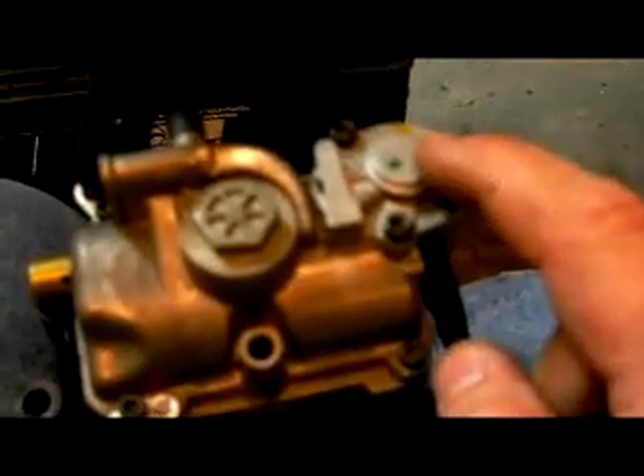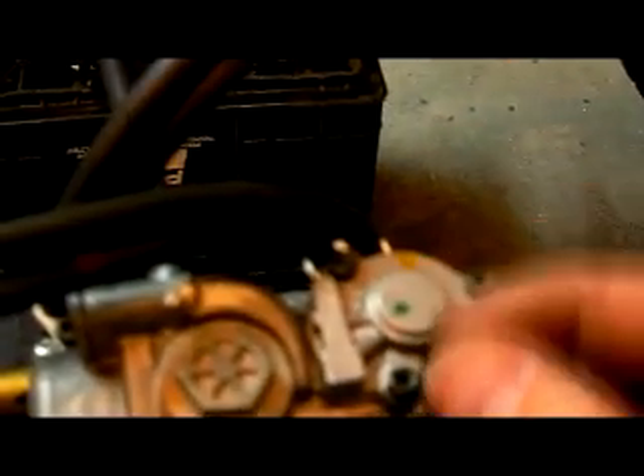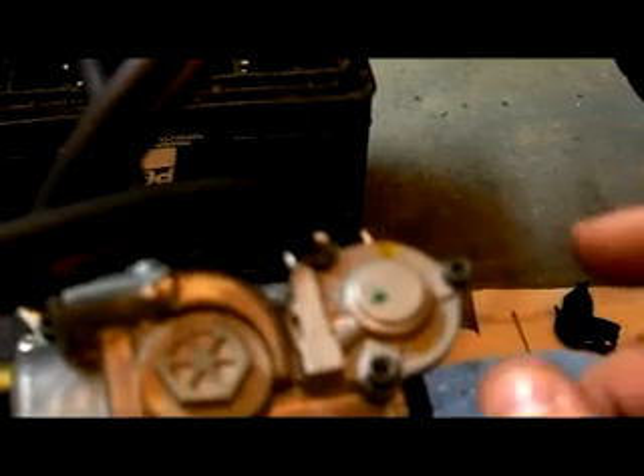Here we are with the carburetor in hand and I'm going to get to work on the JD jetting kit. Under here is the accelerator pump, and underneath that is very simply a spring and a diaphragm. You undo these three screws, lift off this cover, put it down on a rag in the same position, remove the spring, and lift the diaphragm out. There's a little tiny tip that you put on the top of the diaphragm — you sit it on a 6mm socket and lightly hammer that tip on. Once it's on it's not coming off, and it shortens the stroke of the accelerator pump. Then you put the spring back on and those three screws — that's it.